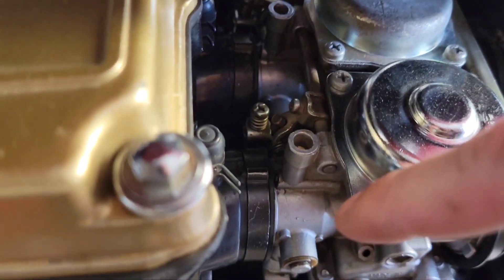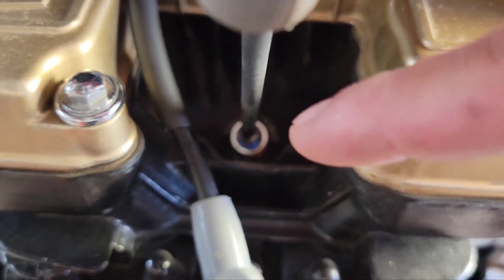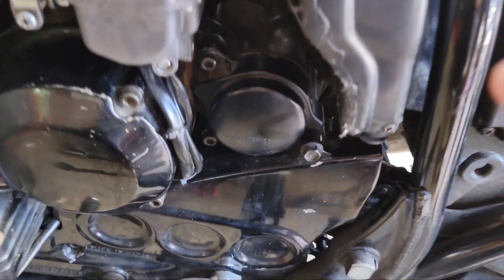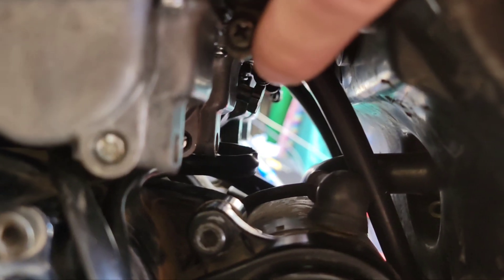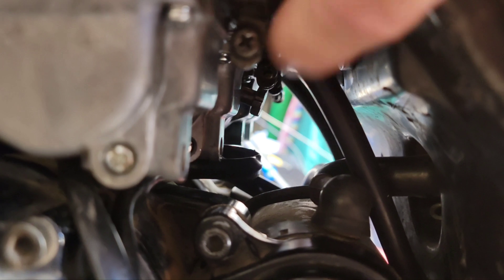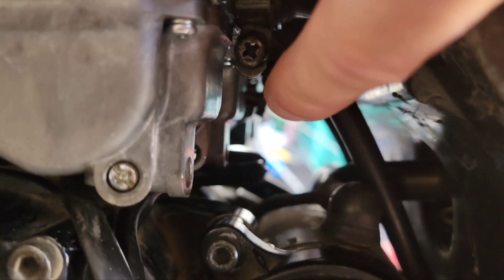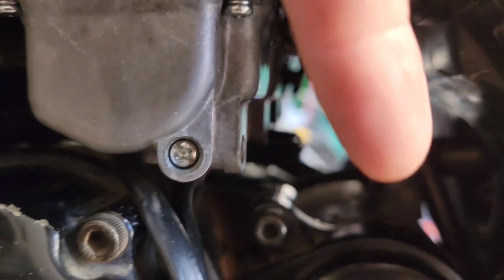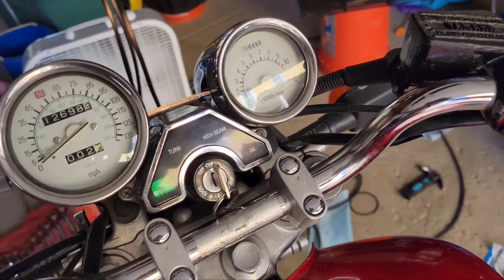All I did was adjust the fuel mixture screw, and I had to put it all the way down, but it turned a nice pretty blue. I also had to change my idle screw — I had to turn it counterclockwise to back it off, and it's idling good again. I've got two more to go and it just dives right back down to proper idle.